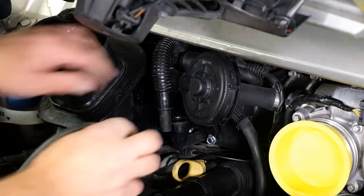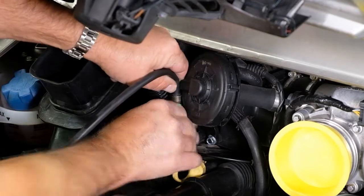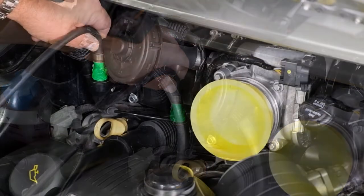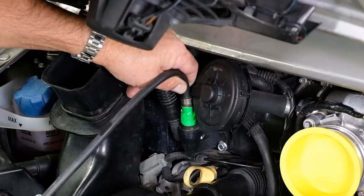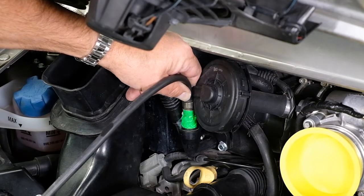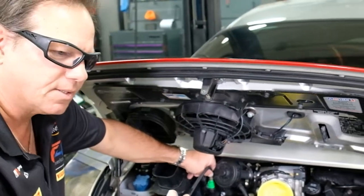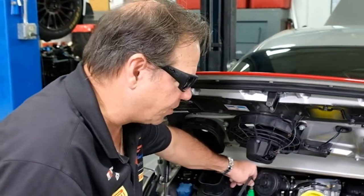Take your connection for your smoke tester and tape it up to size. It seems a little hokey but it works, and it's really the best thing until you find a rubber connection that will allow you to do it. Once you do that, turn on your smoke tester, turn up the volume, and look for smoke. You want to do this with a cold engine because the gaps are large — and this is true on all cars. The intake system temperature does make a difference.